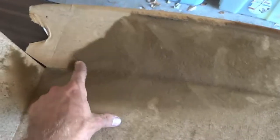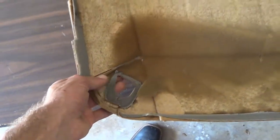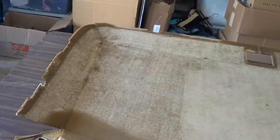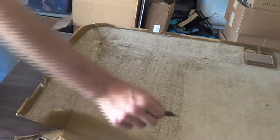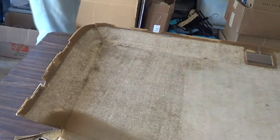I'm going to go around and pull off all the leftover headliner material, then scrape off as much of that old foam as possible — especially in spots like this, because nothing's going to stick to it. I'll probably use some tape on the back to give the fabric something to attach to. To remove all this stuff I'm just using a razor blade, rubbing it back and forth — not trying to slice, just rubbing the surface. You have to do it a couple of times but you'll see how well it works.